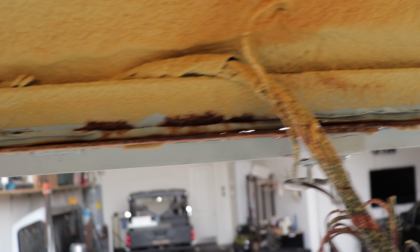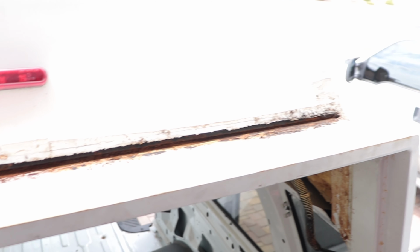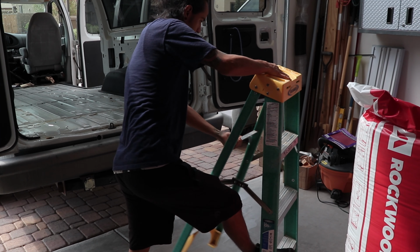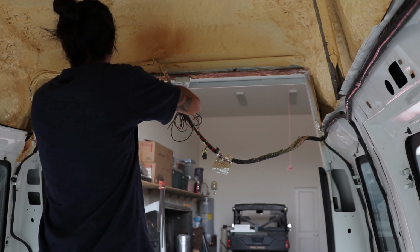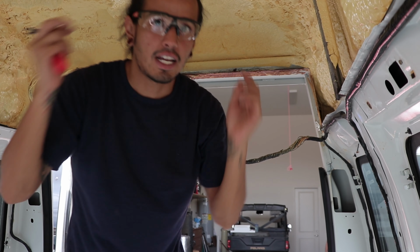We're just gonna, Kaylee's gonna be cleaning the van up, making it spotless and kind of seeing where all the rust is so we know where to sand it down. So I gotta scrape out more of the caulking that's there, the old caulking, and then sand down all the rust and everything, reprime it, and then recaulk it. So we'll find out here in a minute, see how long it takes us. Safety first, guys.